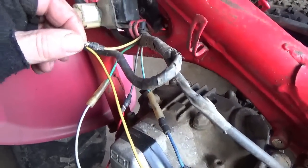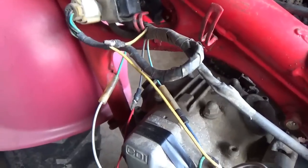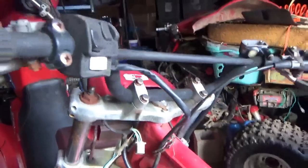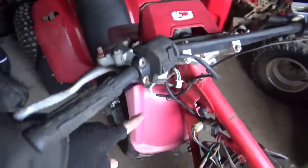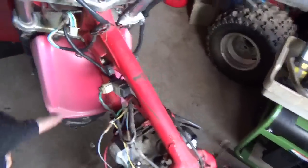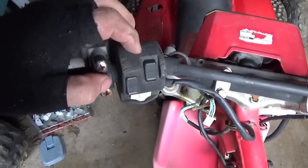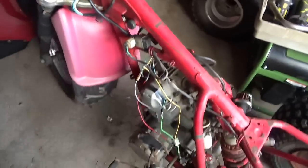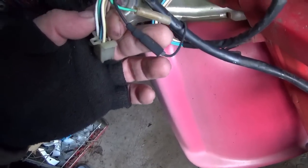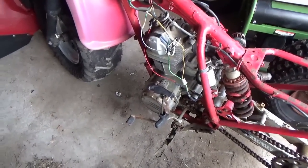The yellow wire here is for the lights. The stator coil appears to be okay, but the switch appears to be no good. I'm able to light the headlight with the battery, but the tail light is gone. If I run the lighting through this switch, I can't light high or low or anything else — it appears the handlebar switch is shot.